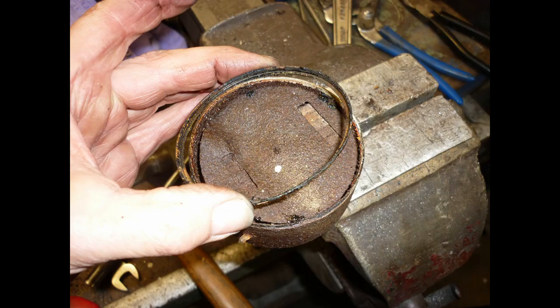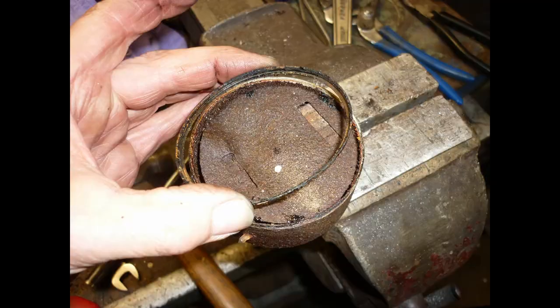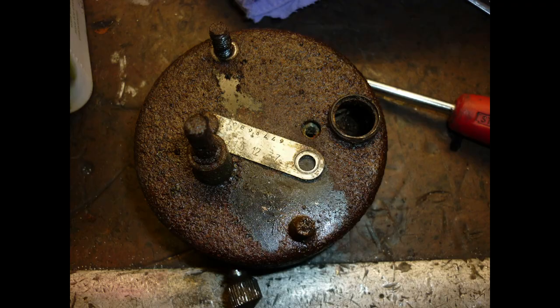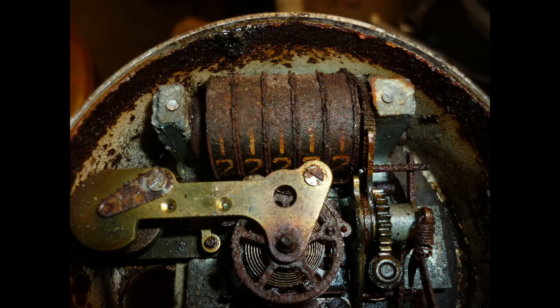Sadly, though this Deluxe Model 40 was equipped with a speedometer, it gives no clue to distance covered in the bike's first life. The question is why Smith's chronometric instrument, the original judging by its 1937 plate, has not only been attacked with a blunt implement, but still shows a row of zeros on its odometer dial. I think I'll leave you to puzzle over that one for now and cobble up a magnetic replacement to tide us over.